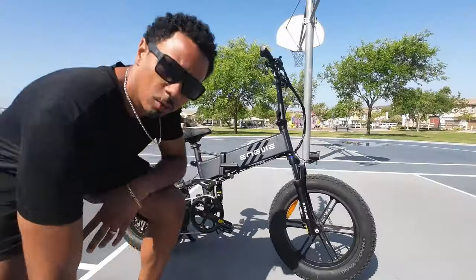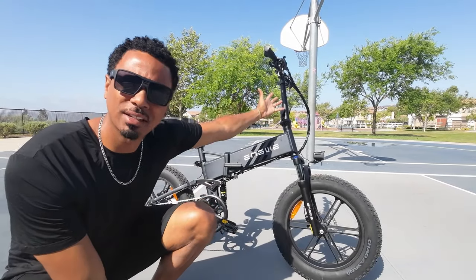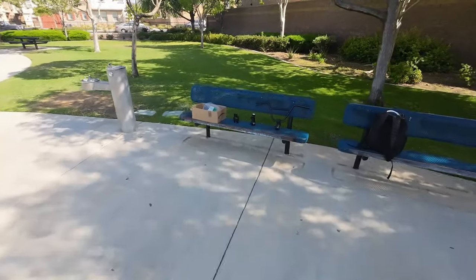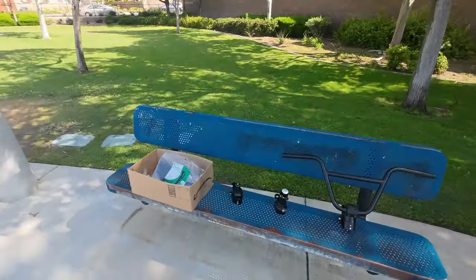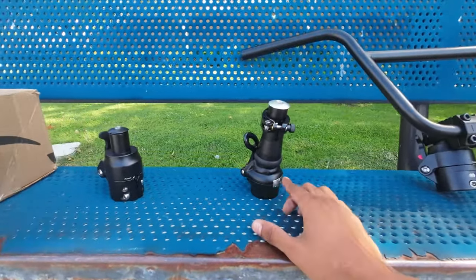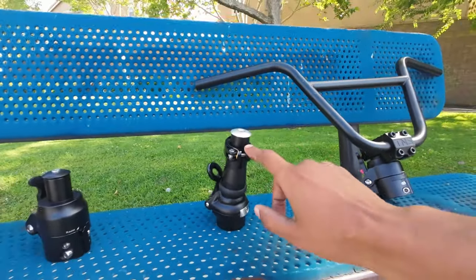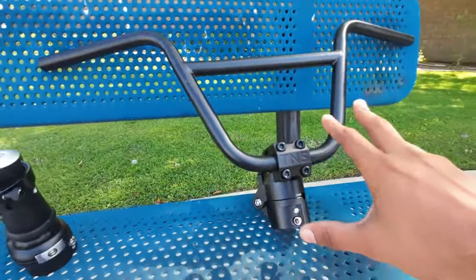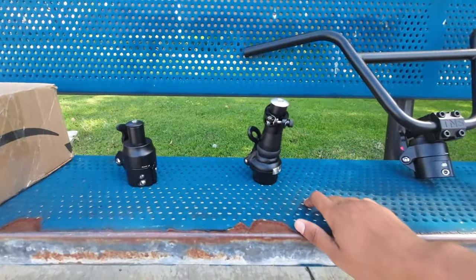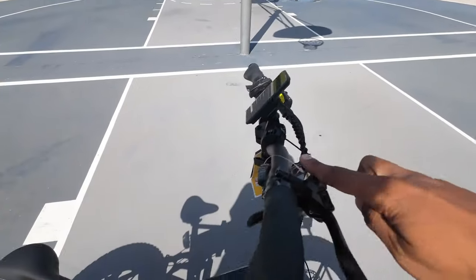It's a brand new day, and we're going to swap out this ugly giraffe neck stem for the turtleneck stem and BMX bars. The only thing I'm trying to decide is which turtleneck stem I want to go with. I have the shorty, but I also have this FX — it's basically a taller version of the shorty, and it's also height adjustable if you want to raise your handlebars, but ultimately it'll lead to the same BMX look. Both will work with this setup. It's just a matter of whether I want the handlebars a little bit higher or keep them short. The first thing we're going to do is take off all these components.